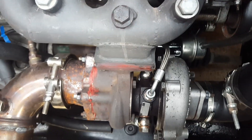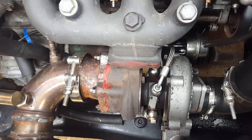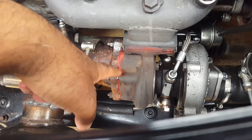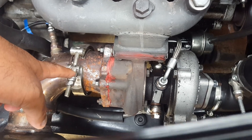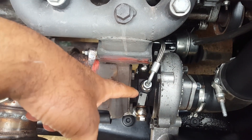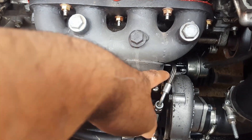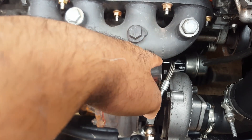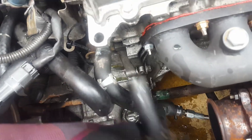I'm gonna have to unbolt everything again. I'm gonna try and leave on as much as I can because I don't really want to undo certain connections. What I'll do is undo the V-band, undo that silicone there, water pipes, oil pipes, actuator off, and then take it over to a mate to get all these lines V'd out and re-welded nice and solid.